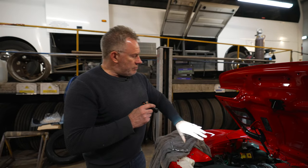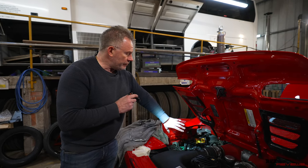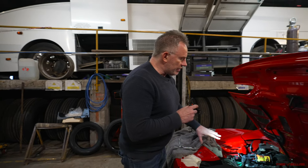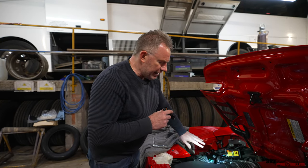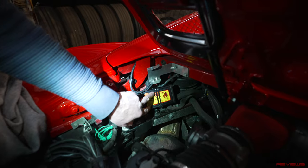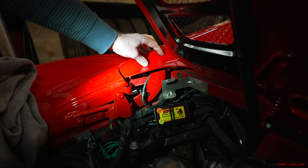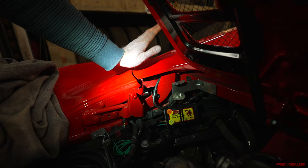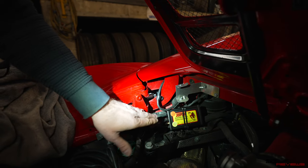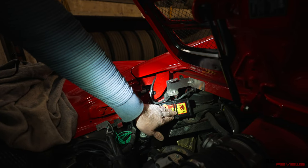The first thing, which has taken quite a while, is removing this side engine panel so we can gain access behind it to locate the Forza controller unit. That's key because you want to keep it away from direct heat and away from damp and moisture. I've connected it using tie clips to the main wiring loom. You've also got to be careful that the controller unit is located away from the tonneau cover hinging mechanism - this lifts when you actuate the roof, so you don't want it banging into or blocking the Forza controller unit.